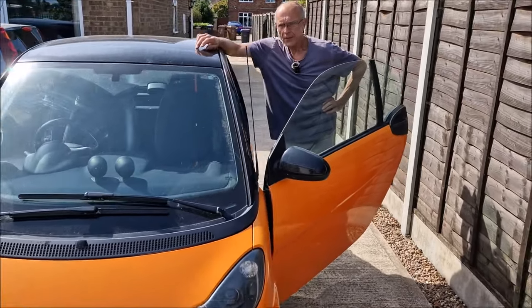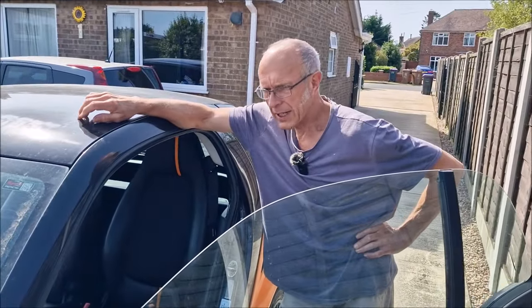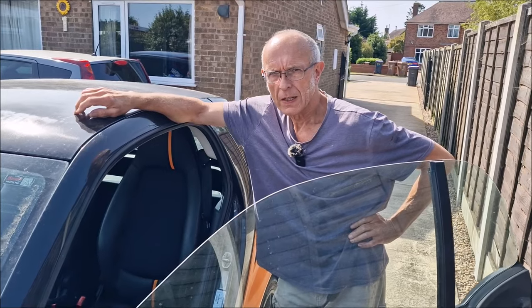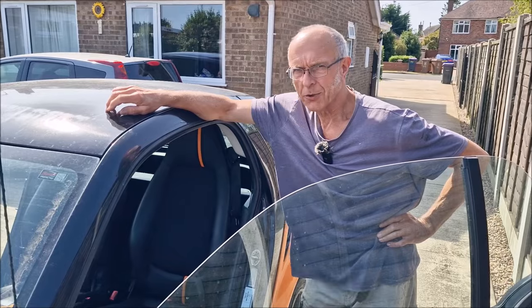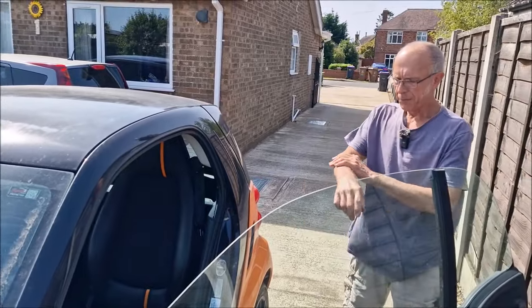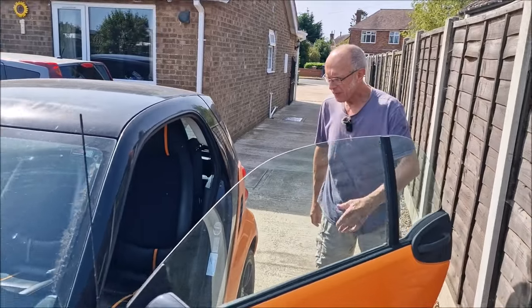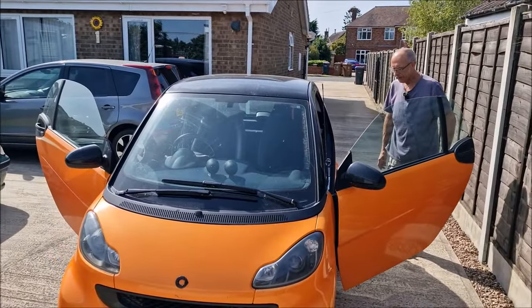So you've done some research on the internet. Only very quickly. What's it showed us? It might be the air conditioning drain. Okay. We need to look. So it could be a plenum drain. Probably. Yeah. But I think this time of the year it's more than likely going to be an air conditioning drain. But it is actually dripping a little bit on the floor. Right. So whether it's leaking up, we don't know. We're going to look. So how are we going to do it? Take the seats and everything out? Not first. We're going to just have a look first. Okay. Right. Let me get sorted. Yeah. We can get the carpet peeled back and have a look.